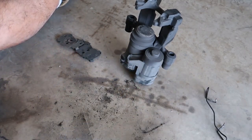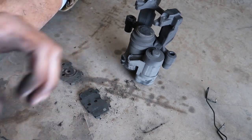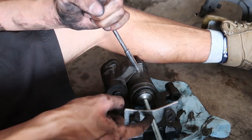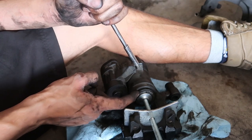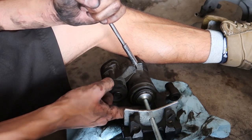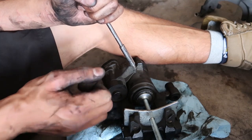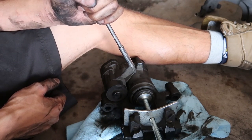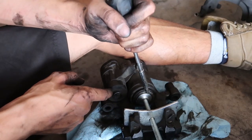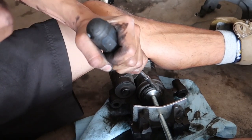Grease the slider pins up, then screw the piston back in. Using this cheap piston tool — the head doesn't spin, it just pushes down. A good piston kit will lock into the slots on the piston face and twist the whole piston in. There are a lot of people who say they just pushed it in by hand or used some leverage — that didn't work for me. I tried it for 20 minutes. With this tool and enough pressure it will spin, and when it gets stuck, I tap a flathead in with a little hammer to get it moving again.